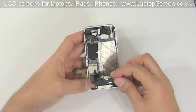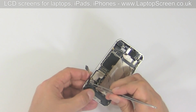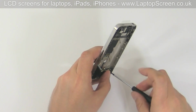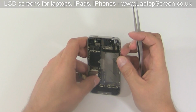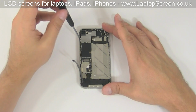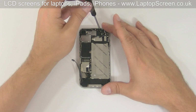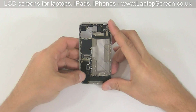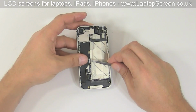Put the speaker box back in place and reposition the tiny triangular plastic spreader. Secure the speaker box with 2 screws. Reconnect the Wi-Fi antenna connector. Replace the top EM shield and secure its 5 location-specific screws. Reconnect the middle level connector and replace the middle EM shield.